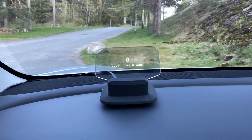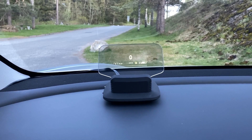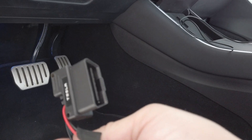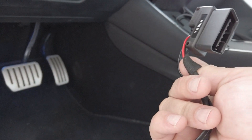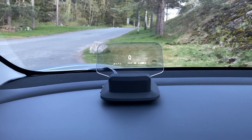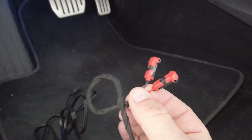You also need to connect it to power. This one is made for the newer cars — I think it's from build date December 2019 and onwards — they have the OBD2 port, which is located at the top of the footwell on the driver's side. What that does is allow you to get the 12-volt connection. This comes with the OBD2 plug and you put it in there and you've got your power. The other two connectors you need to tap into the CAN bus, and that's really easy as well.